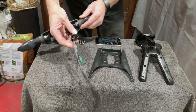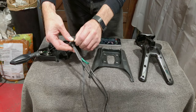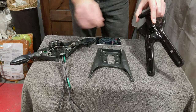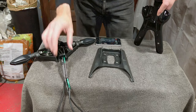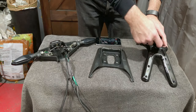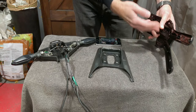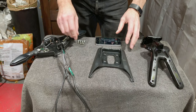Now you've got a rubber plug that sits on the wiring harness here, and it's got a little rubber part here which clips in to the hole in this. So you have to remember to drill the hole if you want to use this. And this seals the water coming up inside this pipe and getting into the wiring, which you don't really want if you can avoid it.